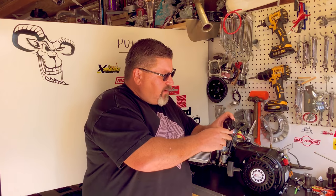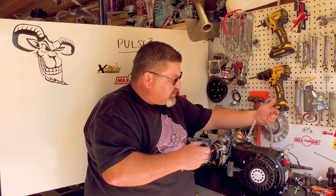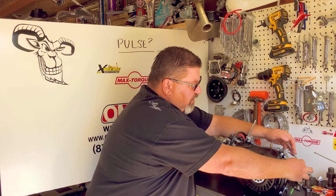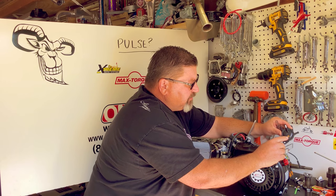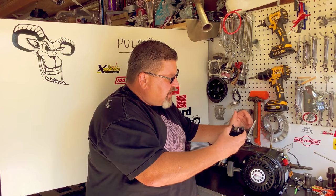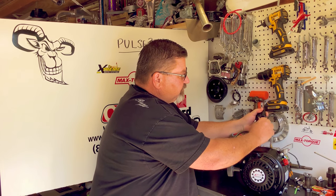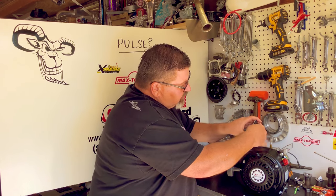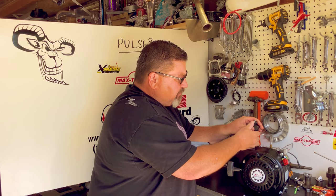When you're mounting this pump, I always like to keep this facing down. As your engine is going, it's splashing oil and creating a very fine mist of oil inside the engine. If you were to run your pump down on the bottom side, this line is going to fill up with oil and mist, and it's going to fill up your pump with oil — then oil will start coming out of this little brass breather here. So I like to mount my pumps up higher, because that way there will be some oil mist in the line but it has the opportunity to drain back. With a simple mount here, you can hook up the hose to the pump, get it mounted on the bracket, and you'll see it's coming up and over — making sure oil isn't stuck in the line and purging out that breather hole.